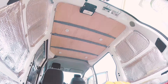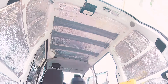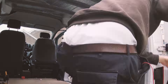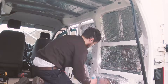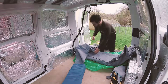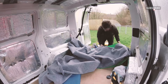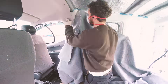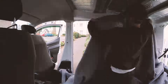Next I needed to remove the plywood sealing panels which I installed in my previous video. I wanted a neat edge when carpeting so I'd need access under these. After cleaning and wiping down the surface of the van with isopropyl alcohol I removed any dirt and grime that might affect the glue. I unrolled the carpet and remeasured to make sure I had the right quantities. I wanted to do the tricky bit around the front and sliding door seat belt column first so I wouldn't find myself short of fabric as I got nearer the rear of the van.